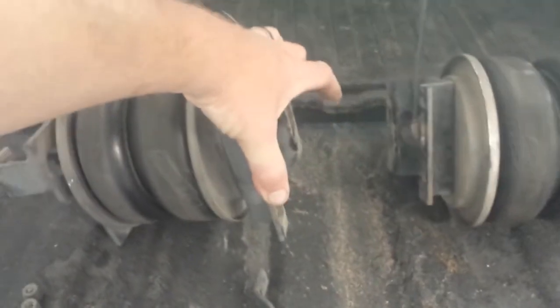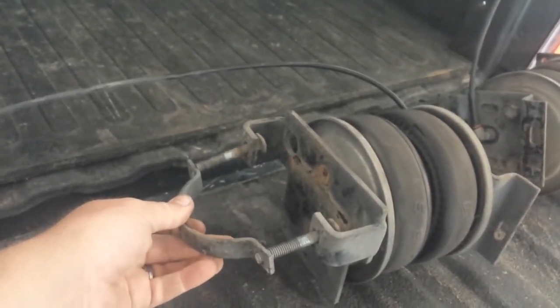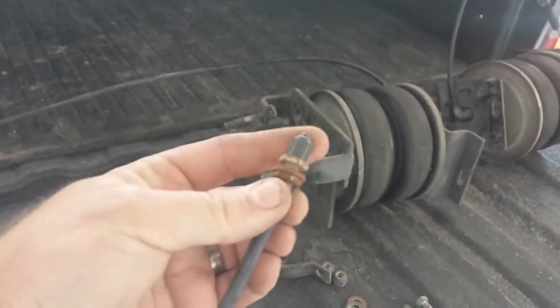It's really simple — you've got two mounting holes in the top where your bump stops are, and two holes for the bracket that goes around your axle, and that's all it is. Just run your airline and put your inflation nozzles in. I don't have a T-fitting crossover on this — just two individual nozzles, which is fine. It's one less place to leak, so I like it that way.